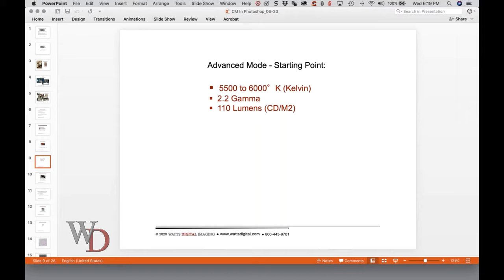How often to calibrate? Monitors have a tendency to drift color-wise, so you're going to want to calibrate and reprofile on a regular basis — approximately every 60 to 90 days. In a lot of newer monitors, you can probably go 90 to 120 days. It only takes about 15 minutes. If money is an issue, since you only need it for 15 or 20 minutes, maybe you can get together with another photographer or two and share it like a library card. Laptop monitors are notoriously hard to calibrate and tend to drift really quickly. The only exception is MacBook Pros — they have very robust graphics cards.